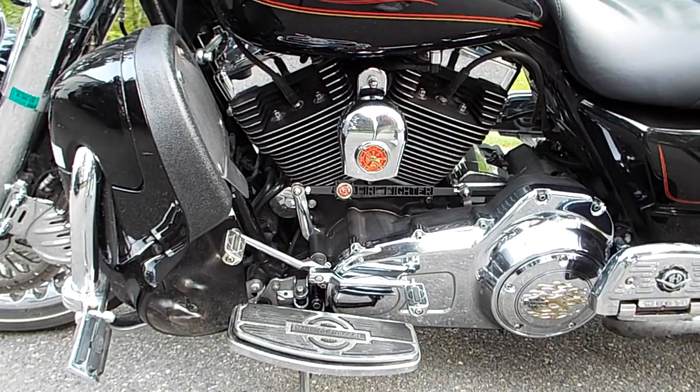I can feel just a little bit. And that's to be expected because that spring washer is acting like a shim now. And it's taking up about at least an eighth of an inch of the space in there that there was before. So with an eighth of an inch less than it had, the springs in there compressed a little bit more than they were before. I couldn't turn the sprocket by finger.